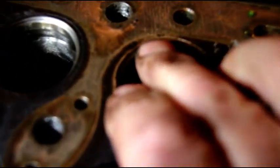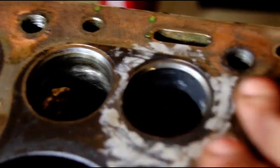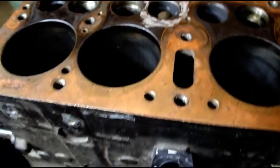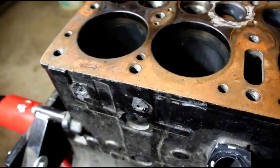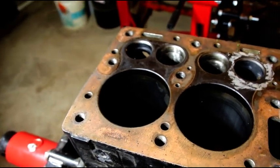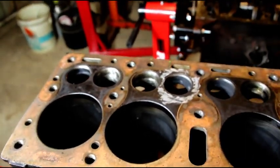Others are severely beat up by the valve bouncing around — there's stuff my nail can catch on. This one seems okay. I don't know who would do a valve job like this — maybe somebody in their backyard with rocks from the driveway. The valve job is horrible, we're not sealing, nothing good is happening here — the valves aren't sealing at all.